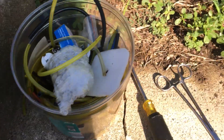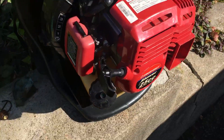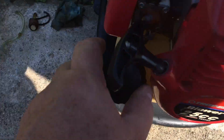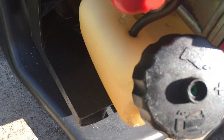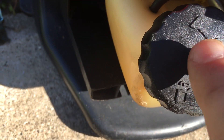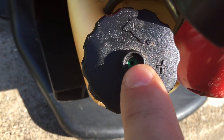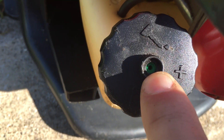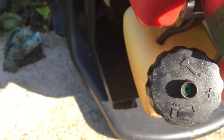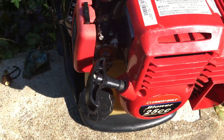I picked out some Echo line, cut it up, put it in — took me probably 15 minutes altogether. The cap was really messed up. You can see the duckbill valve in the cap; there's usually a ceramic piece right here that blocks off fuel flow if it ever comes out of the duckbill — that was missing. But the duckbill is still working, so I took it out, cleaned off all the varnish. Let's see how she runs.